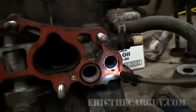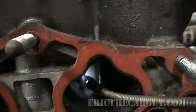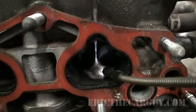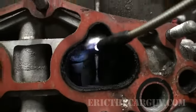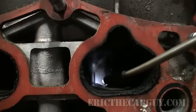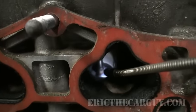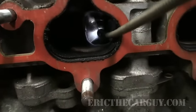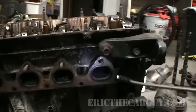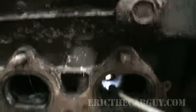In the case of a fuel-injected engine, you have air all the way to this point, then fuel is added at the last second while the intake valve is open. In a carbureted engine, there's air and fuel in each one of the individual runners. This orange stuff is the intake gasket, sealing the EGR and coolant passages. Check it out — there are the valves. These are the intake valves and they're both closed right now because there's no camshaft in there. Notice how this area in here is all clean — that's where the gasoline gets sprayed, while every place else is kind of carboned up. These are the exhaust valves — instead of stuff coming in, stuff's coming out. This is the beginning of your exhaust system.